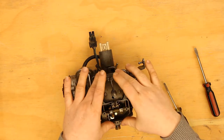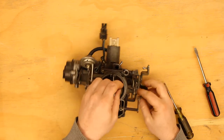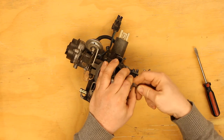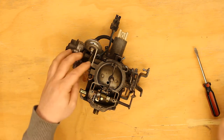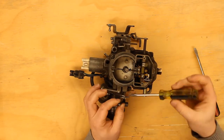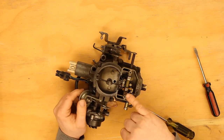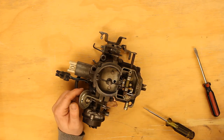I need to get the top third of the carburetor removed to get a better look inside. To do that, I'll take a screwdriver and take off the choke linkage here. Pop it off — I'll put that there — and the same thing on this side. The cover is missing because I just took it off to evaporate the contents of the bowl faster.